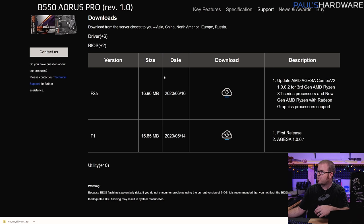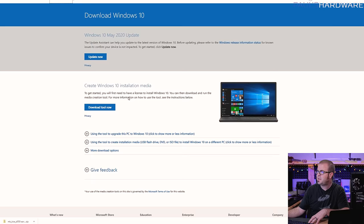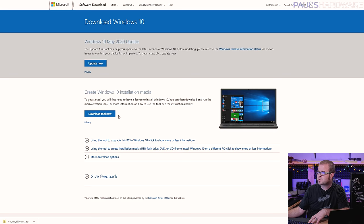Now that's all we really need for the next step, but just while I'm here on this other computer, I'm going to go ahead and do a couple other things. One is to download the latest Windows 10 installer — they call it installation media and there's a tool for that. You can go to the Microsoft.com website, which I will link in the description, and just click download tool now. That will download the latest media creation tool. Then I'm going to take my USB drive, make sure I don't have anything on it I want to save, because it's going to be completely erased, and I'll plug it into my other computer.